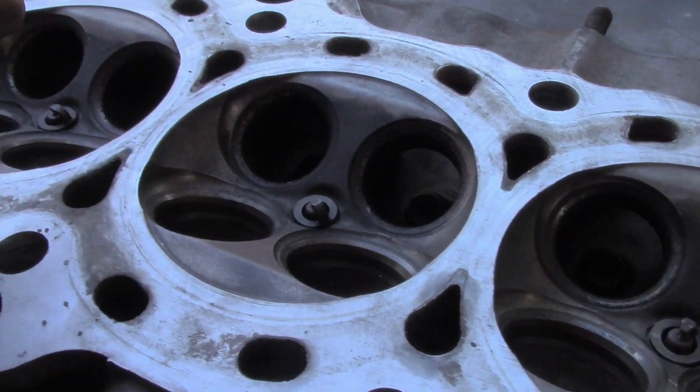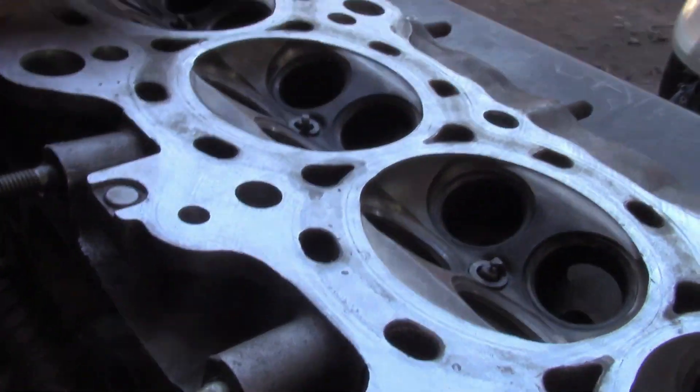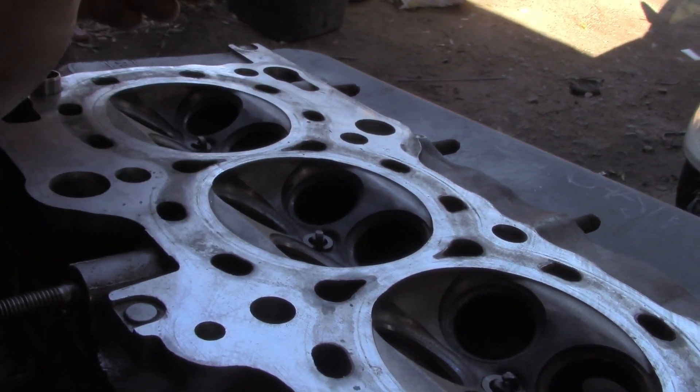This one's kind of dark, this one's dark, and this one's darker — so some of the valves got bent by whoever was driving this car. The Euro R head also has damage right here where a piston came up and smacked it, so I'm going to have to find a way to get that repaired, otherwise the head is useless. I've seen people TIG weld, fix it, grind it down and smooth it out, but I don't know anybody who knows how to TIG weld.